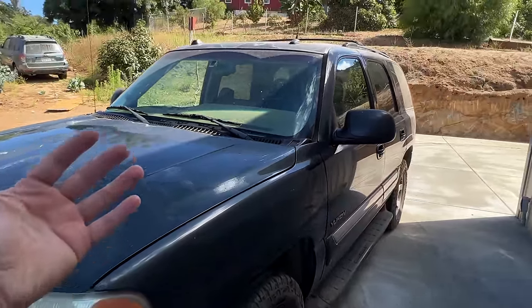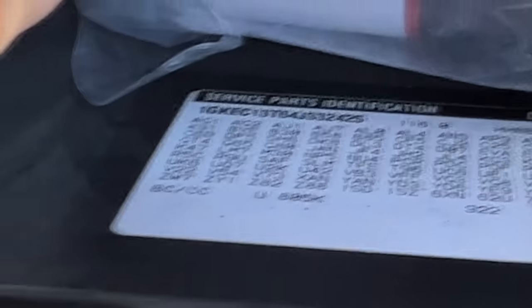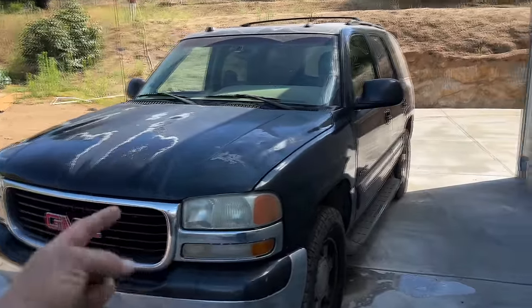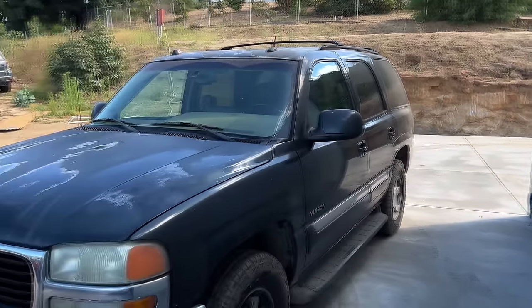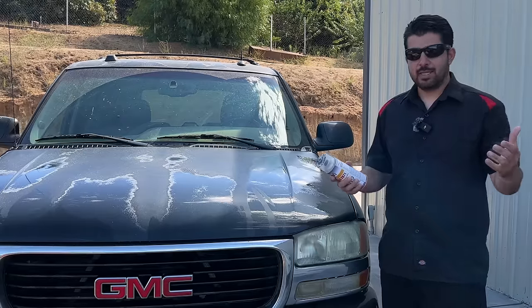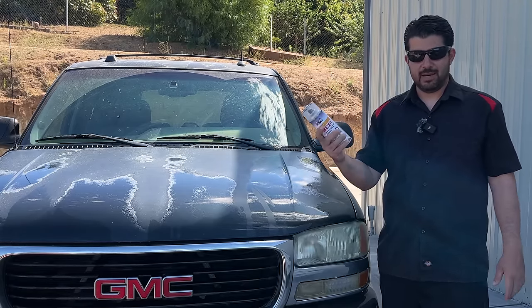You need to find your paint code. On this car, the paint code is on a sticker in the glove box, and as you can see it says 805K. On different makes and models, that paint code could be on a sticker underneath your hood, on the driver's side door jamb, or on a sticker in the trunk or the spare tire well. You simply have to look up the location of your paint code on your car's make and model and find it. Then you take it to your local automotive body shop supply store and tell them to mix that code into a can for you. And that's what I did — here you can see 805K, dark spiral gray, the name of this color.